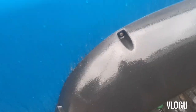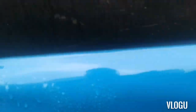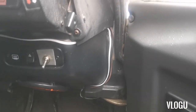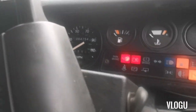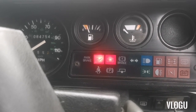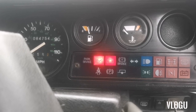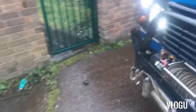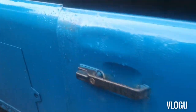So that's all in — cap back on. Right, we're going to start it up and show you. Make sure your glow plugs are in good condition for this. The fuel light should go out now — I've put 10 litres in. Fuel light's out. You can see it going up to around a quarter of a tank, just under. It started first time and it's running.